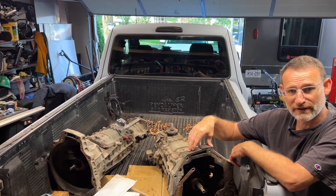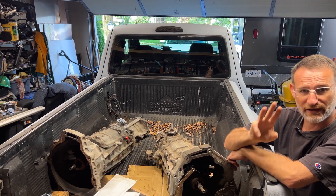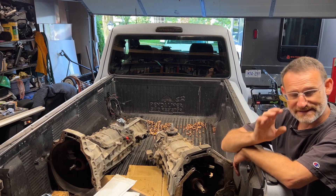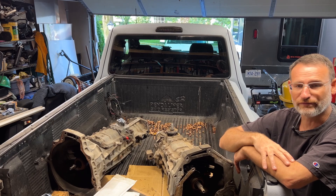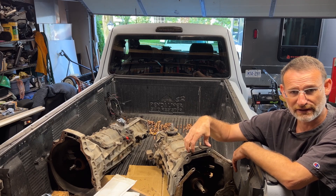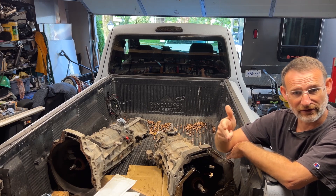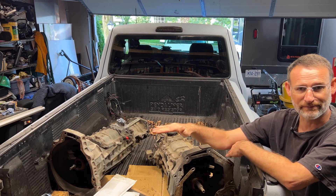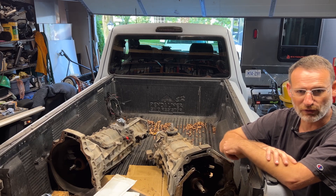So why are we going through all the trouble to take this apart and put it into that one? Well, what it does is it gives us a lower first, second, and third gear. I'll post in the description if you want to see the difference in gearing. For myself, when I built my truck, I used 4.56 gears rather than 4.88s — I probably should have gone with 4.88s if I wasn't going to do this modification. But with this modification I get that low gearing for first, second, and third, but then when I'm on the highway, fourth, towing, or fifth, it's the exact same ratio. So that works out really well — it gives me good fuel economy but still good towing power.